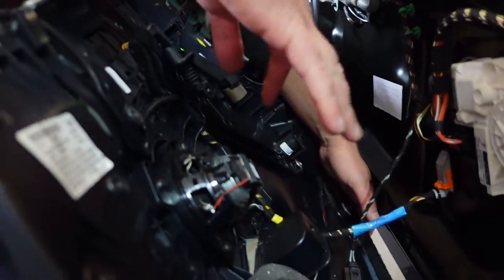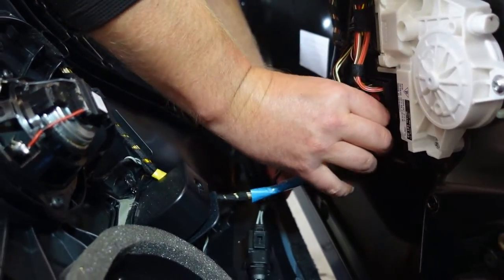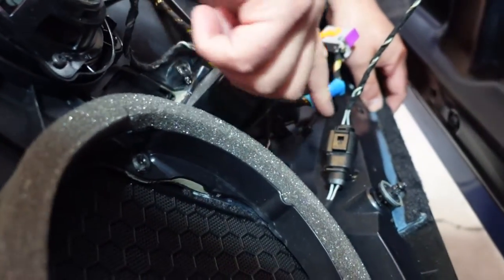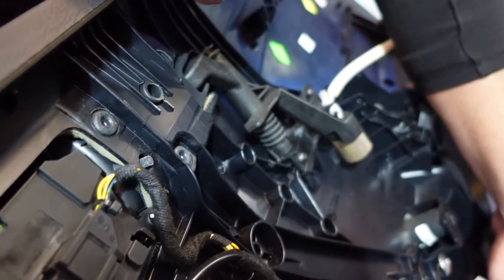So you've got to pull this pretty gosh darn hard, but nothing broke. If you look in here, you've got to disconnect a couple of these wires. There's a little clip — with your finger you pull this out. This one I might need two hands for. We're going to disconnect that and then take out this door handle. That's it, nice and easy. We'll be right back.